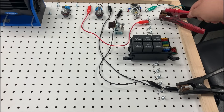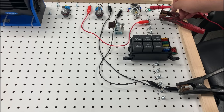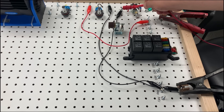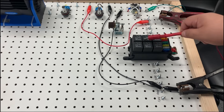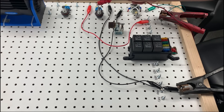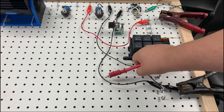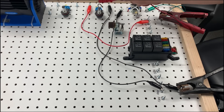Here's my ground circuit, here's my positive circuit, and these two are going to be acting as my battery. From there we're going into my input for this pull switch. My output is located here, which I'm running to pin 30 of one of six relays. Then I have my output 87 here, and that's running to my power feed for this particular headlight. And my ground, which kind of looks like it's overlapping but it's separate.